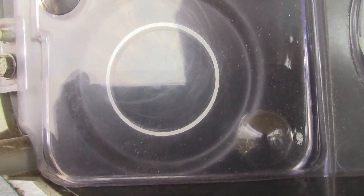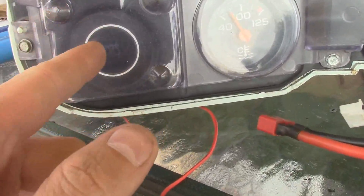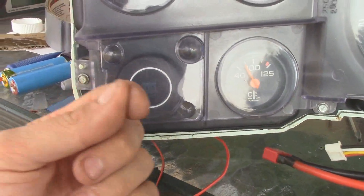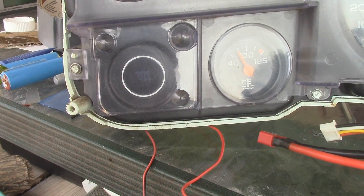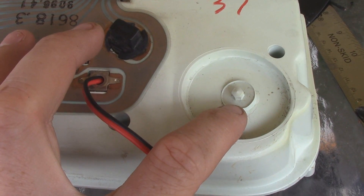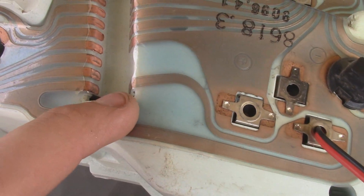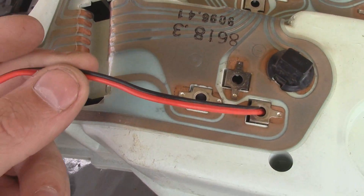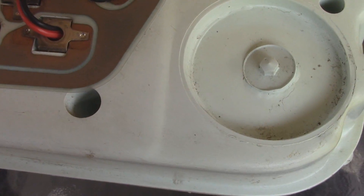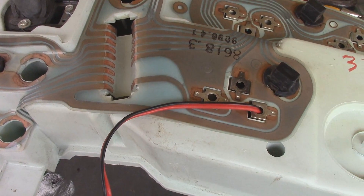And you can kind of see it. And then yeah, when you turn it on, it's really bright. Then I just glued that lens — Blu-ray case — to the black piece and then glued the bottle end to the Blu-ray case. The LED just press fits into the back; it's not going to fall out, it was actually quite tight. That's how I did that. Then I used a proper resistor on the cathode of the LED and ran the wires out the nearest hole.